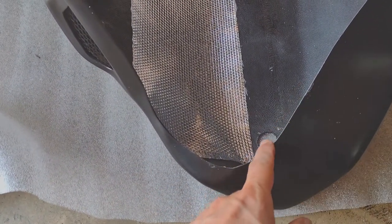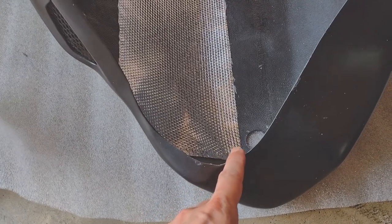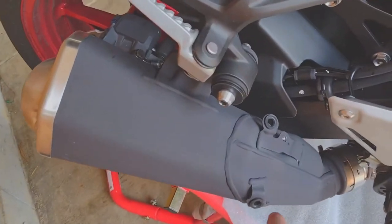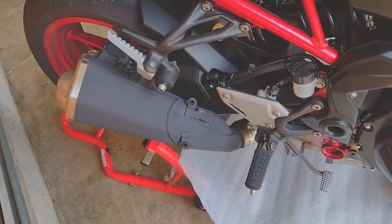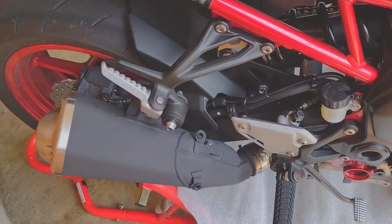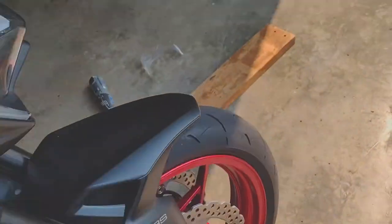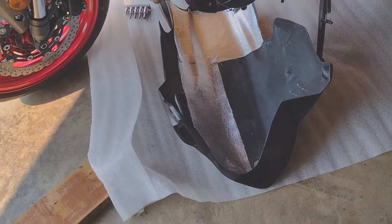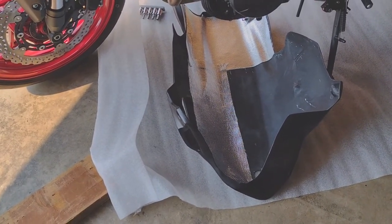First issue: I did a test fit and it's totally rubbing right here and I cannot get the holes to line up. I have to Dremel — there's a little grinder sander disc on there, hopefully it'll just eat away at it a little bit. I also completely removed the heat shield off of here. It looked like it wasn't going to fit, but now I might end up putting that back on because it may have been something else — like the headers — making it not line up. I'm going to grind a little bit on this and hopefully not mess it up too bad.